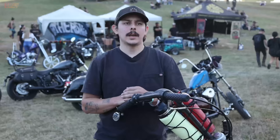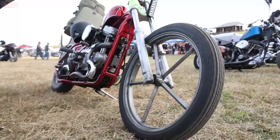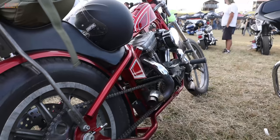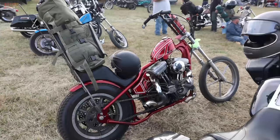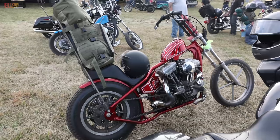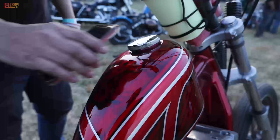I'm from Duncanville, Texas, and I brought this 1992 Sportster Hugger. It's an 883, but it's punched out to a 1200. It's got the Haefely Bros kit, which now is Throttle Addiction. Everything to hold it together: sissy bar, seat, oil tank, Mullins narrow trees, Invader front wheel, stock rear wheel, tiny, tiny tank, 1 1/4.